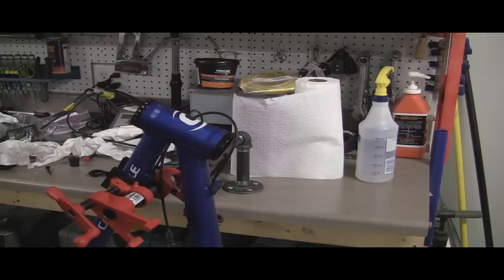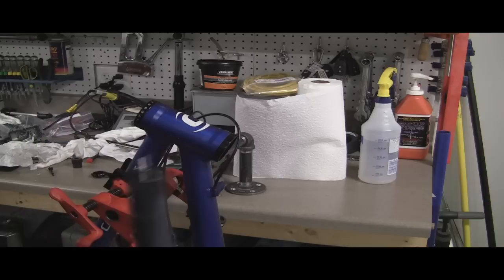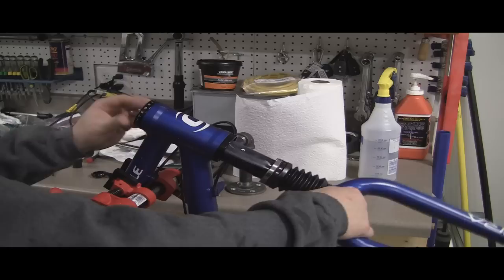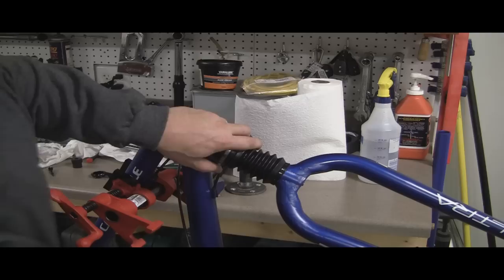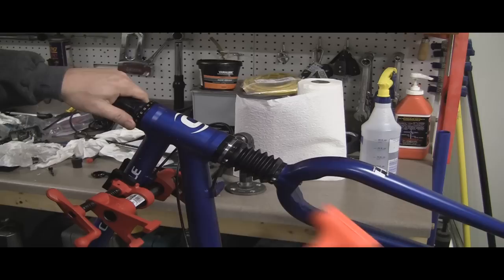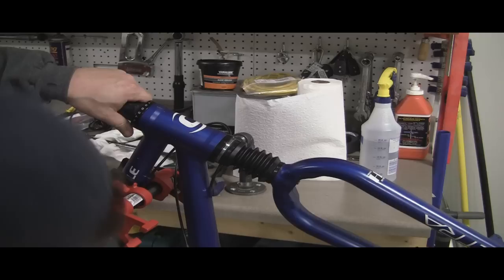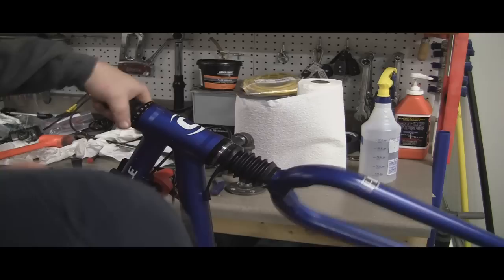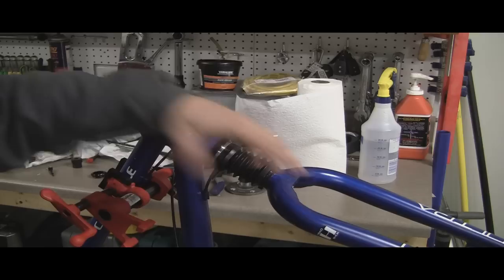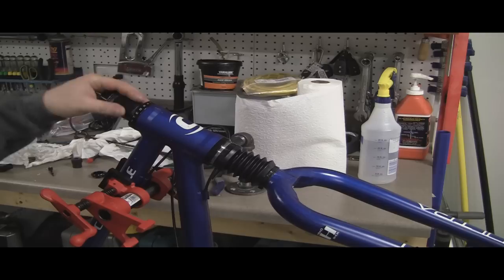I've got the bike sitting here in the stand like this — it's a little easier to put it that way. I did put a little grease on here, though that's not a requirement. You want to get this as straight as possible going in. It goes in fairly easy — it's just this bottom bearing here that's the tricky part. They actually make a special tool for this, which I don't have. So make sure you don't hit your Schrader valve, and go ahead and tap on either side of the fork, slowly alternating per side until that pops in. Sometimes it goes right in — but it just takes a little finesse.